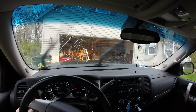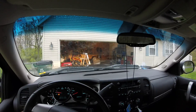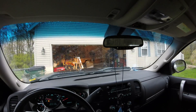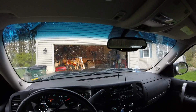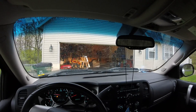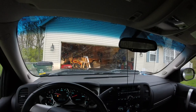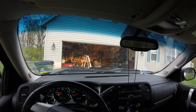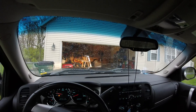That's full speed — it might not like going full speed because it's not wet enough. The Rain-X on there makes it just kind of wipe real dry, that's the only thing I can think of. Everything's tight. Hopefully this will get you by for a little while. It didn't take much — just a small drill. It's just aluminum on the outside until you get to the post. I drilled into the post, the splined part, which is hardened steel — it's pretty tough steel. You can tell when you're hitting it. I drilled into it just a little bit, blew it out, and started spraying oil in there a little bit at a time. It doesn't hold much, but it worked. Hope it helps.